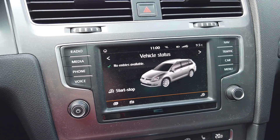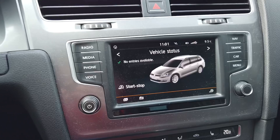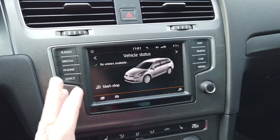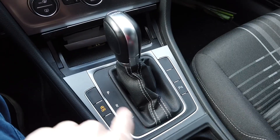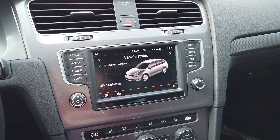It's as simple as that — just make sure the pressure is correct. If there's a puncture in your tire, you'll need to fix or replace it first. Once you're sure the pressure is correct, press the Set button on the infotainment or the dedicated button on the center console if you have one, take the car for a quick spin, and it should be fine from now on. Give me a thumbs up if you liked this tutorial and see you soon in future videos.